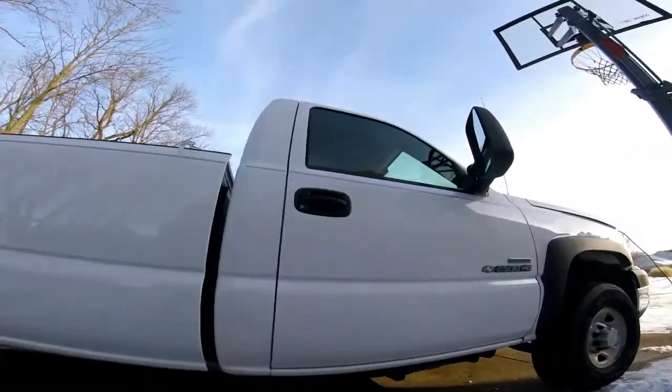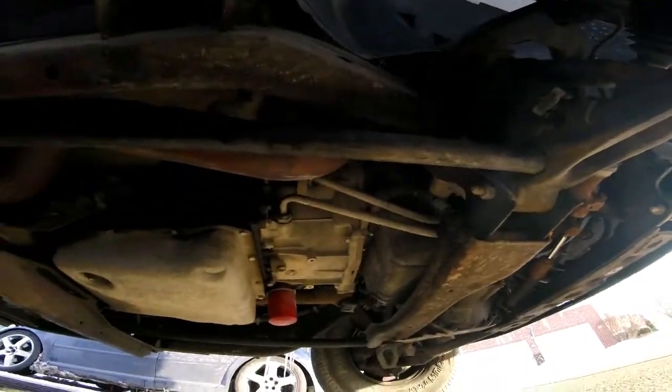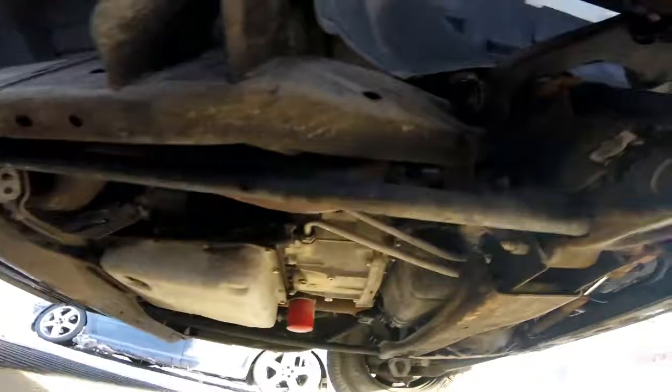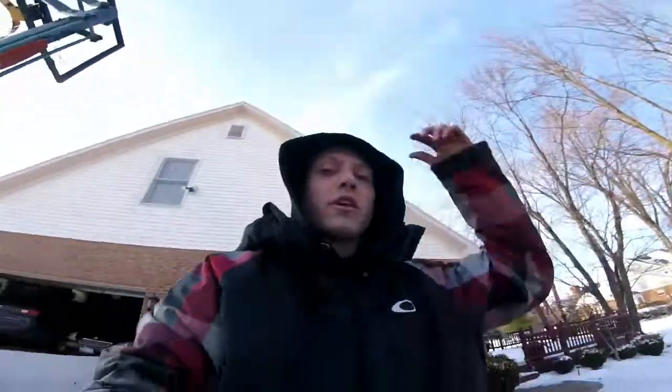The next step, right after the downpipe, is like a weird curved section, and then a catalytic converter. I don't know if you can see that up there, but I'm hoping I won't have to cut it there because my blade on the Sawzall is too short to get through the actual pipe. So you have to cut it from both sides, which is super annoying.